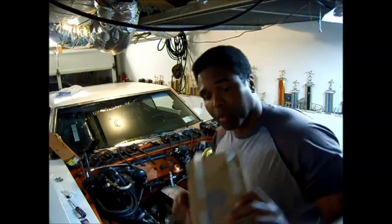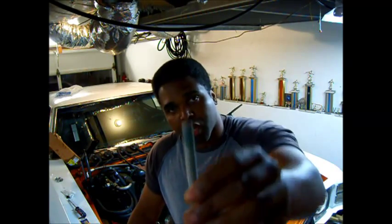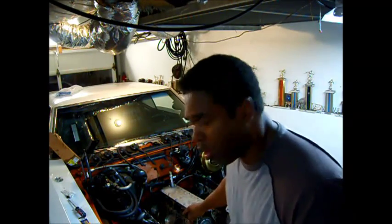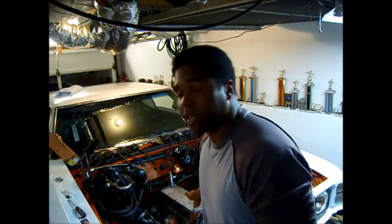So these are my new head bolts, GM. When GM installs the heads and installs the bolts, there's some type of bluish-greenish stuff that they use — their version of Loctite. You have to remove as much, if not all, of it out of the bolt holes. If you do not, you're not going to get a proper torque reading. And worst case scenario, I've heard horror stories on aluminum blocks where they actually crack because the stuff was still left in there.